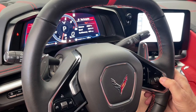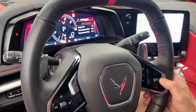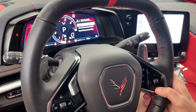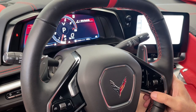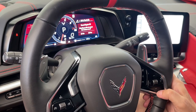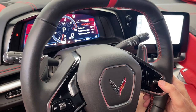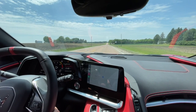We need to scroll over to Maintenance — watch the screen — and we've got our engine oil at 2%, and we'll select Reset Engine Oil and then Yes, and now it is reset to 100%. Of course, the last step is a road test.